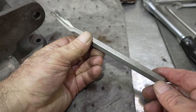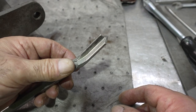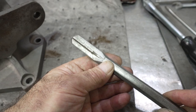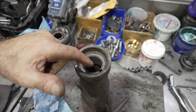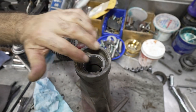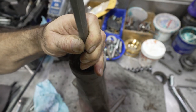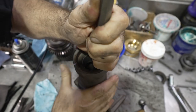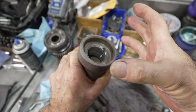To take the bushing out, I don't have a bushing driver so I use an air chisel tool. This particular tool is typically used in the exhaust industry to take mufflers apart — it cuts the sleeves of the muffler pipe. In all these tail housings there's a little groove to recirculate oil around the bushing. The punch fits perfectly in there and allows me to punch the whole thing right through. It slices the bushing, the bushing collapses, and you can take it out.